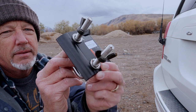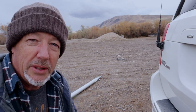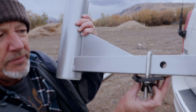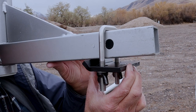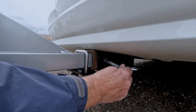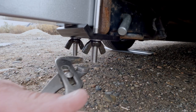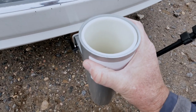The way around it for me was adding a hitch tightener — a simple little device I picked up at Harbor Freight. I'll put a link in the description. Depending on whatever trailer you're pulling, this can also help reduce the noise from rattling. How it works: it slides over the top of the bracket, and this little gap fits in here, pushing up against the receiver to tighten it down and keep it from moving. I put wing nuts on the bracket so I could hand-tighten without extra tools, but I've discovered I still have to tighten it down with a wrench. That thing is going nowhere now.